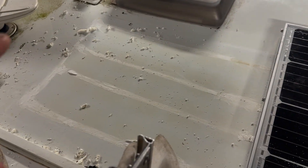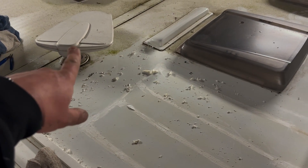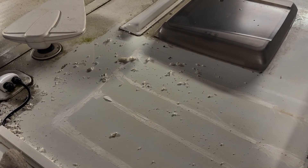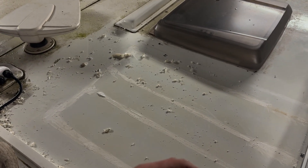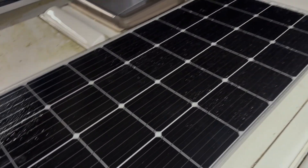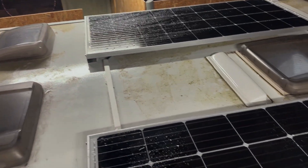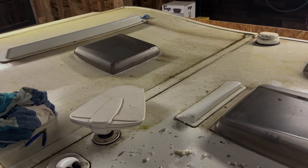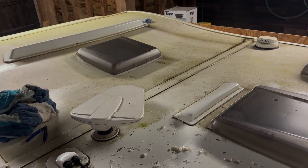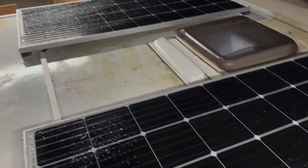Up here on the roof, this is where the Truma solar panel was. The trouble with its placement is that it's so close to the TV aerial — when that aerial swings around, it shades this panel, so it wouldn't have been very productive at the best of times. With the aerial up, it would cast even more shade, so that panel was probably producing very little when the aerial was pointing backwards. We removed it and replaced it with two 185-watt panels, fitted as far back as they can go before the roof seam, making good use of the space. Up front there's the dome, where you don't really want a rigid panel, and it's very busy with the windbreak — so this rear placement makes the most of the available space.